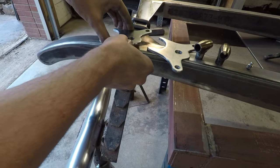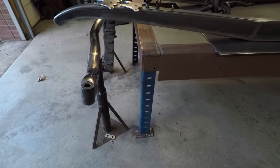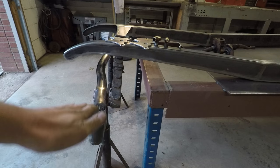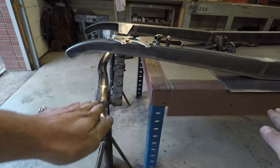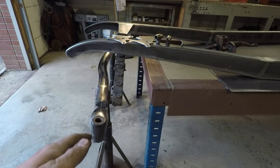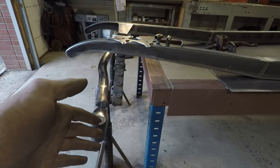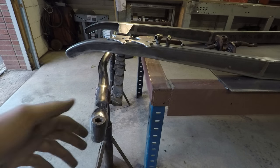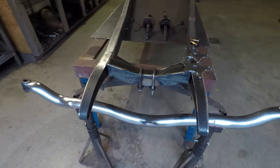The reason though the four bar suspension is better is because as this axle moves up and down, like say you go over a bump just on one side and one side raises up, when that's just on a single pivot point over here, this front axle tilts up and it wants to twist. And essentially what that does is it forces the front axle to be used as a sway bar. And that works with the I-beam axles like a lot of the early Fords had, because those are able to twist a little bit. But these tube axles don't twist along the length there.